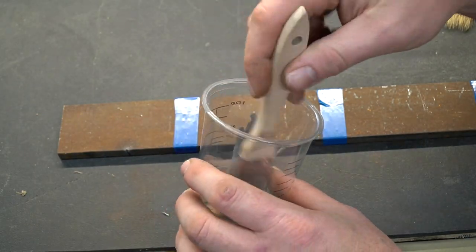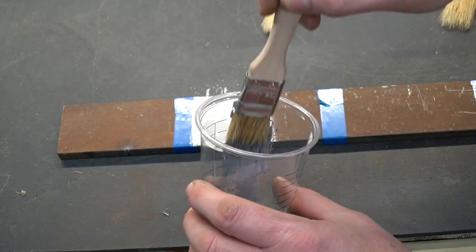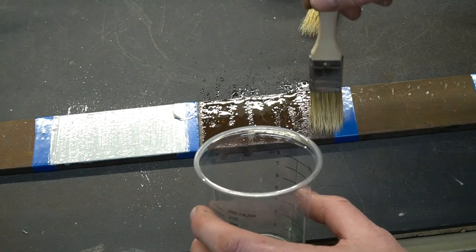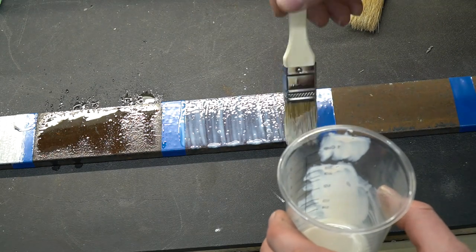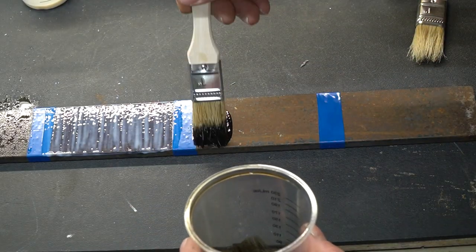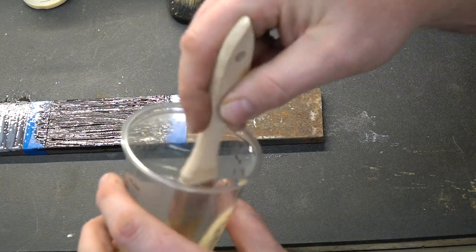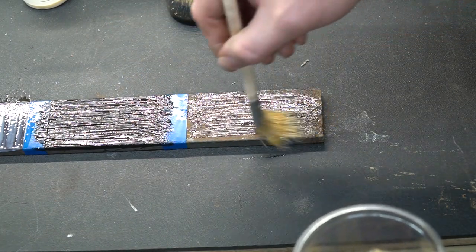This is the Eastwood Platinum Encapsulator — you can see it's very slimy but it coats very well, and typically one coat is all you need. Ospho is very runny, like water. Corroseal is white like milk — a little thicker than milk. New Hampshire oil we normally spray on, but we're going to brush it on today; there's nothing in the rules that says you can't brush it on, I just find it easier to spray. Fluid Film you also normally spray on, but we put a little in a cup and we're going to brush it on as well.